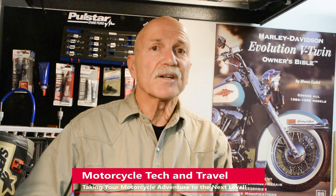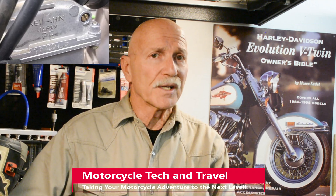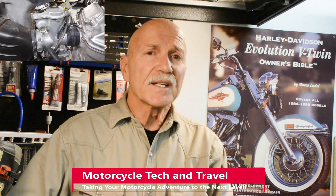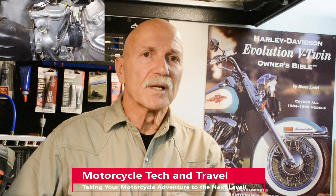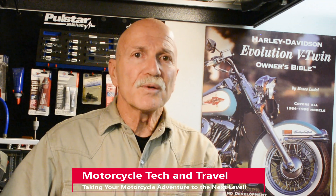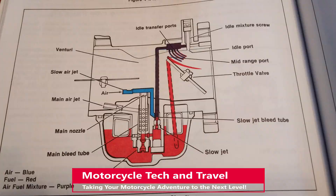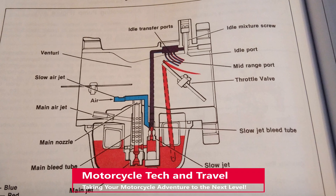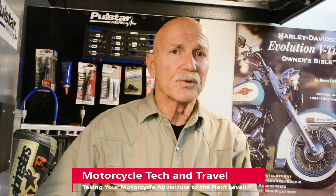Those familiar with Keihin or Mikuni dirt or high-performance motorcycle carburetors — like the Keihin PE Series on my Honda XR650R — expect to see a needle attached to a slide, with the needle opening fuel flow through the main jet into the venturi. The slide lifts mechanically as the throttle cable pulls it upward. Instead, the 1986-1987 Sportster carburetor is more like an automotive design, with bleed tubes and venturi effect drawing fuel into the air stream — there is no needle. As the throttle opens to the mid-range circuit, it still draws fuel and air through the idle circuit's transfer ports, then adds a direct supply of fuel from the float bowl.